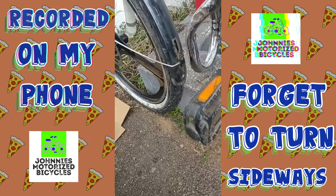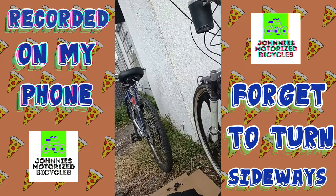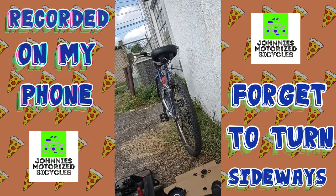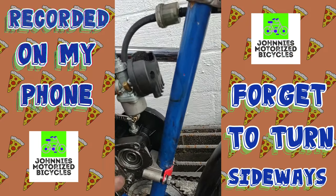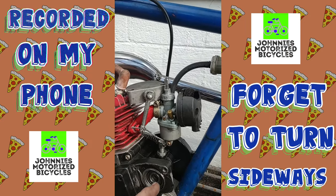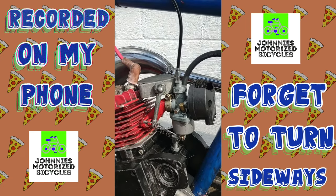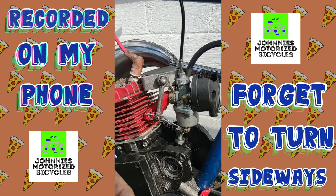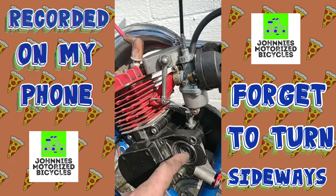The clutch did come a little loose on me. I just thought it was adjusting, like breaking in a little bit, and it wasn't bad, so I didn't really pay it any mind. I just adjusted the cable and kept it moving, and today on the ride, literally within a couple minutes, I had to adjust the cable again. I definitely thought it was weird, started to take notice, and within a minute or less later, I had to do it again, which I didn't do. I just came right home to rip the clutch apart.